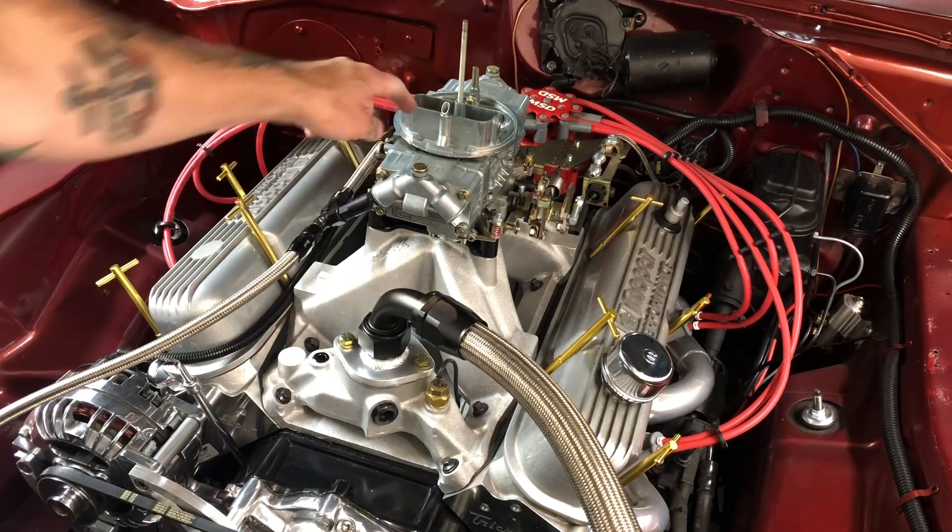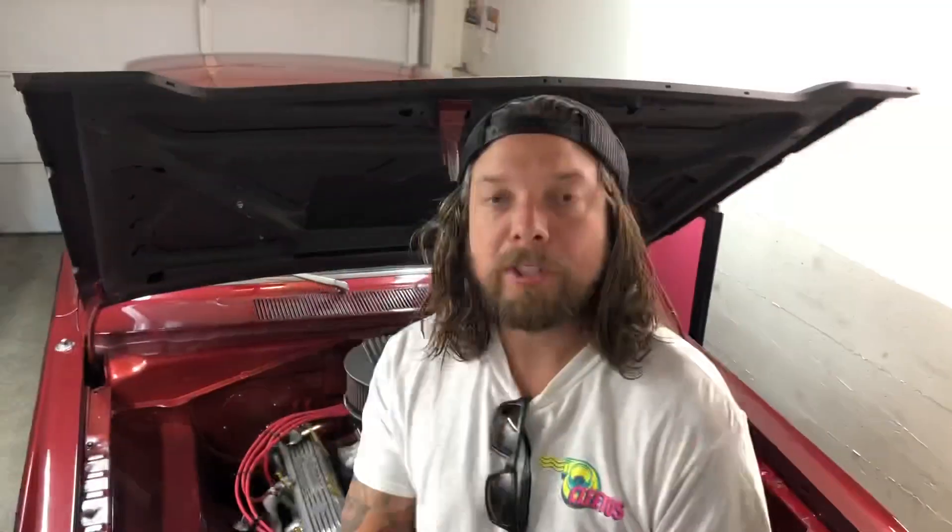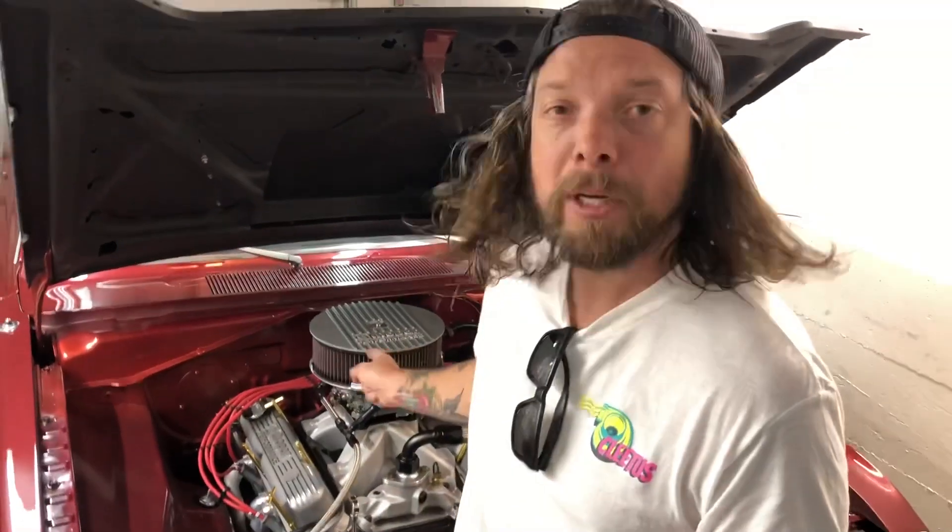Okay, now I can just fill the float bowl through the vent and we'll get a good fire-up. So the jet change is done. Originally when I was cruising around I was seeing a lot of 12 — at 12 on light acceleration, and even when I dip into it just a little I'd see 11.5 to 12. Around 2000–2500 RPM where I'm kind of cruising at, doing about 30–40 miles an hour, I'm seeing 12 dead even, maybe 12.5. I'm looking to get about a half to three-quarters of a point leaner — more around 13 — just a little bit cleaner of a burn and save a couple bucks at the gas tank. We'll fire it up, make sure we got no leaks, and then back it out and hit the street.